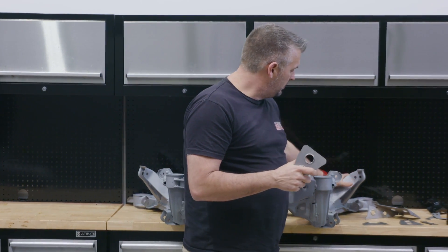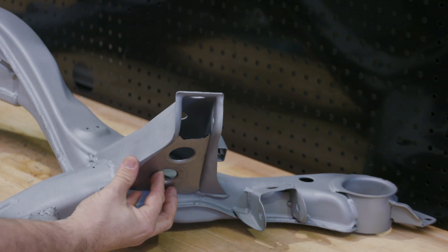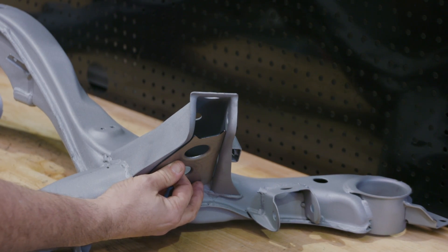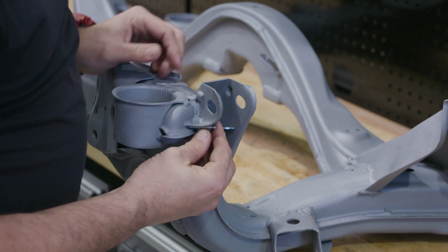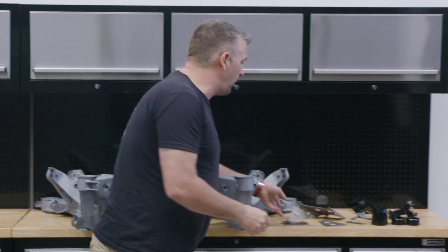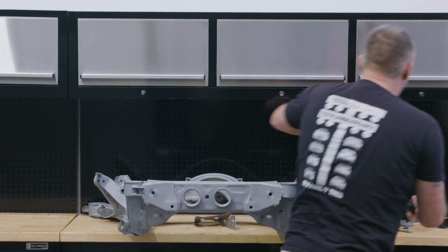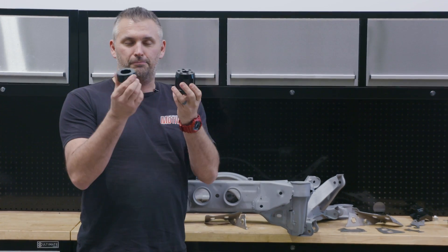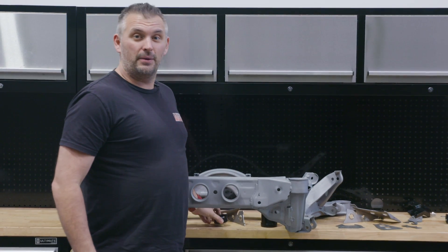The easy bit is this part — it basically goes where the traction rod crossmember sort of bit sticks out, which can actually flex and be a bit weak. This just gets welded down in here and that reinforces where the traction rod joins up. You have another one here: this little bracket goes into where the camber arm joins up and basically reinforces that bracket as well — boxes it off to make it stronger. This next part is for bracing the lower control arm rear pickup point, but we won't be able to use this one for the front since we're custom making a new pickup point. Once all of this is done and powder coated, we'll press in the new solid bushes for the subframe and for the diff. So now we're heading off to Grim Performance because Dennis can weld a lot better than me.